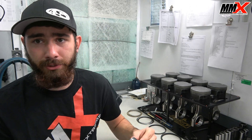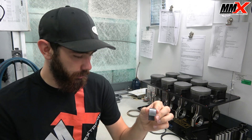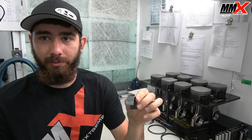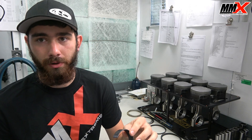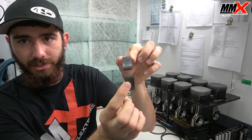The camera's not going to want to focus here, but the bearing is marked with the part number — it'll say H or HX on it — and it also has upper or lower right under the part number. What you're going to want is in each connecting rod, you're going to want one HX bearing and one H bearing to give you the proper rod bearing clearance. You still need to have the upper and the lower, so in each rod you're going to want an upper bearing with the lower half in its proper orientation.